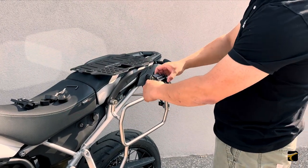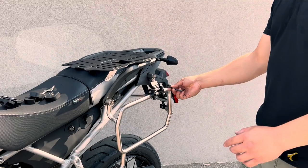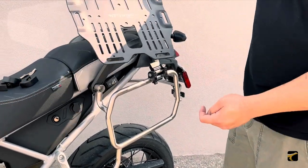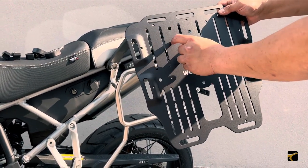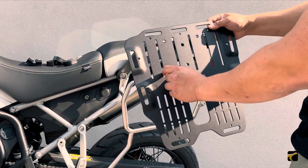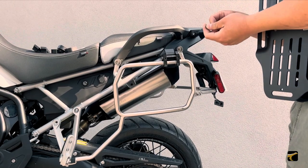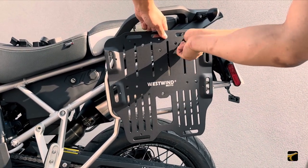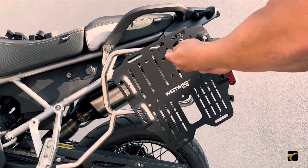To get it on, make sure the screws are facing you and find the right place where you want the mount to be installed. Once that's in place, fully remove all four screws. With all four screws removed, take the metal backplate and line it up to the mount points on the bracket. On the backplate, you'll notice there are gaps on top allowing attachment of the quick release clamp either to one side, in the middle, or off to the other side. Once it's in place, insert a screw to hold it, then get all four screws on — but don't tighten them just yet.